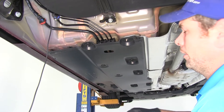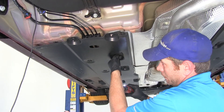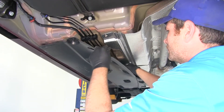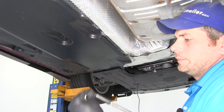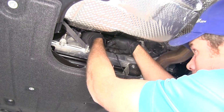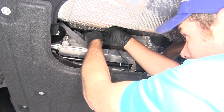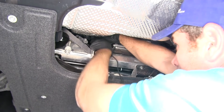As we work forward, we're going to run up above this panel to keep everything nice and safe. We'll just pull off these 10-millimeter plastic nuts — that will allow us to drop the panel down just a touch and get the wire behind it. Once we're beyond there, we can come up and run right up to that front driver-side corner like we talked about. If you still have that coat hanger, you might want to attach it and try to use that to push the wire through.